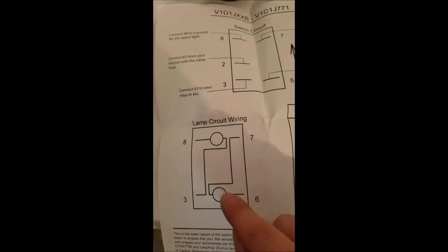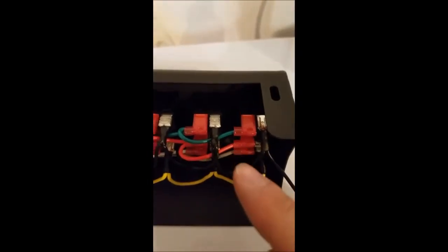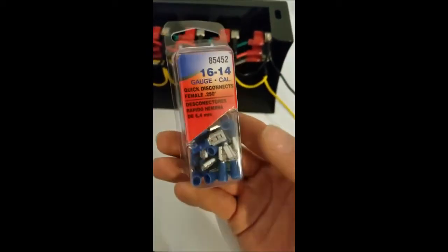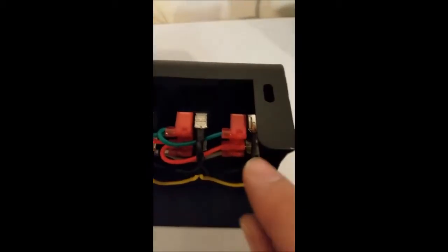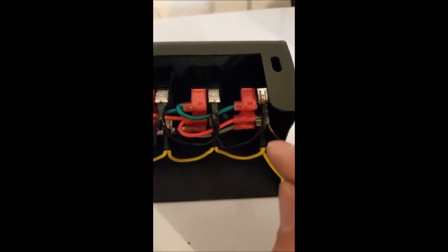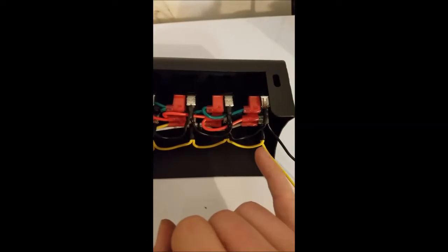Since I replaced all the switches anyway, I made my own little wiring harness for the bottom LED. This is just 18 gauge — probably overkill for LEDs, but no big deal. You can get a better look from the black wire. I used some 16-to-14 gauge connectors; since I was doubling up the 18 gauge, it worked quite well. Take one of these, take the blue piece off, twist your wires up, and use some heat shrink tubing on each. I channeled my inner electrician for 12-volt wiring, and basically just daisy chained each one for the power and the ground for that lower LED — prong 6 for power and prong 7 for ground. The yellow is obviously going to be for the power — our dimmable power source — and it grounds through the black wire.